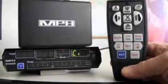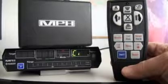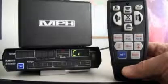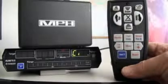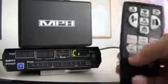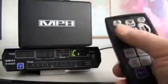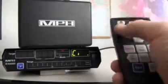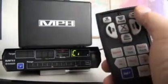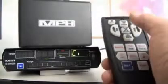What we have with the Ranger also is a very ergonomic looking remote that we have been using for over 10 to 12 years with the B3. We just use the same type of remote with the Ranger. So those users that have used the B3 and some of our other products will be familiar with this particular remote. Very easy to understand. For example, all of the upper buttons on the remote are raised. That allows the officer to just feel those at night and understand where the lock button is at, for example. The opposite direction, same direction, standby buttons, front antenna, rear antenna, and of course on the Ranger, the rear alert button, which puts the rear alert into effect. So those are very good buttons to have.